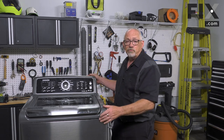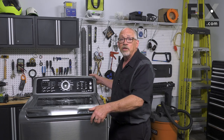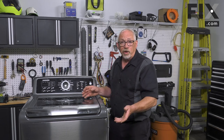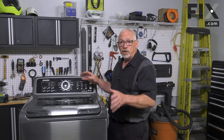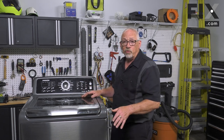Other machines are released simply by putting a putty knife in between the cabinet and the top, pressing in, and that'll release them so they just swing up. Depending on the machine you have will depend on what you have to do to raise that top. On this one we've got it set up so that I can remove the top completely in order to show you exactly how to get at those suspension rods once the top is out of the way.